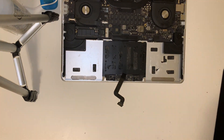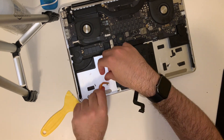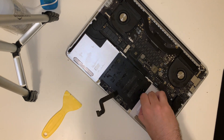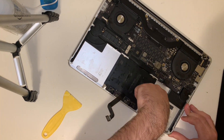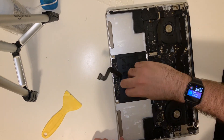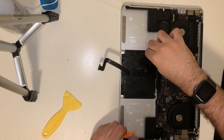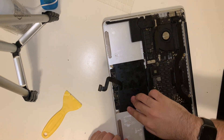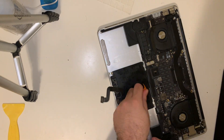At this point you've probably seen other videos on YouTube, mainly from device repair shops, where the new battery is immediately installed. But I've decided to use the plastic scraping tools to remove the old adhesive residue to ensure that our new battery will have good adhesion with the housing. It's worth pointing out that the black piece of metal that covers the trackpad is raised and not flat with the rest of the battery installation area, so when scraping from the sides you have to be aware that you may just be hitting the side of the trackpad.